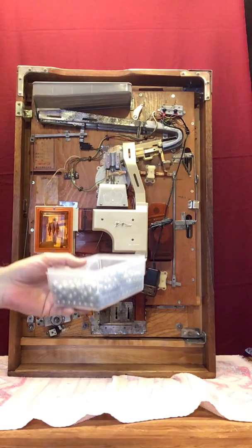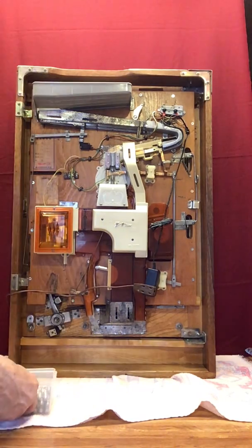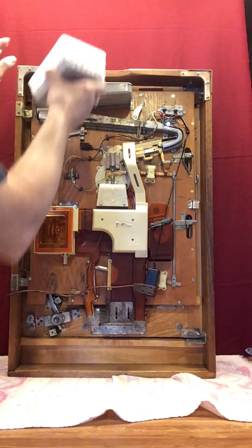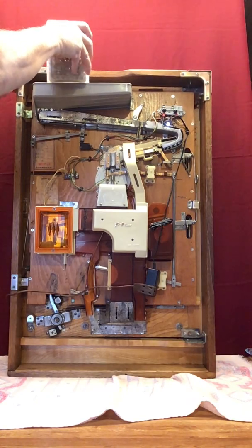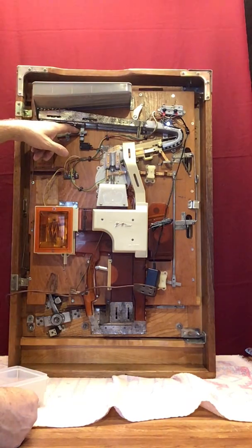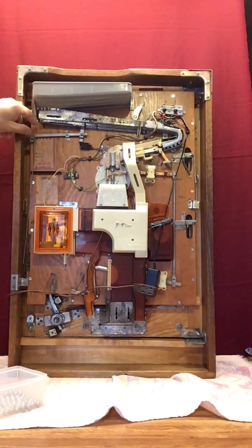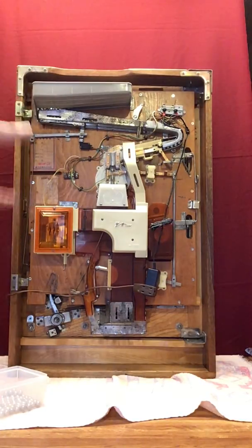So this piece and the seesaw are two things to check before you put pachinko balls in. You'll need something like this Tupperware container down here to catch the balls as they exit the machine. The bulk of your pachinko balls are going to go in the upper hopper. Once loaded, your light should come on. It's still pretty stiff — just a matter of working it a bit — then it'll lay on that switch and turn the light off. You've got plenty of balls, and when you start to run out, this should lift up enough to turn your light on.